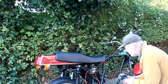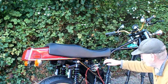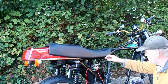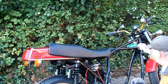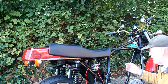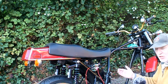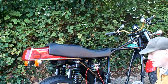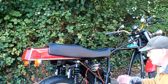I'm pretty happy that I worked out from first principles what was going on with my M unit. The fix was that I had the earth on the M unit itself but not the other earth to the frame, which would be the main earth on the bike once the main battery is in place. Everything seems to work, which is a huge relief. I can't yet test the tacho or actual speedo since I haven't got the GPS speedo sender - that should arrive in two or three days. The bad news is the Motor Gadget keyless ignition system - called M Lock - is out of stock everywhere in the UK and even on the German Motor Gadget website, so I may have to just fit a standard key or wait.